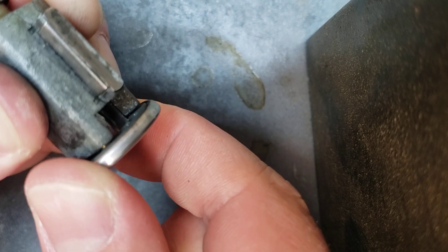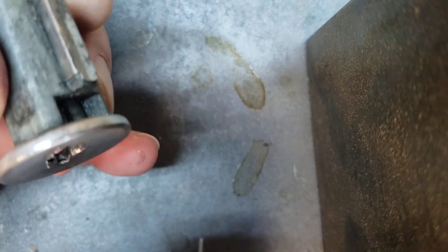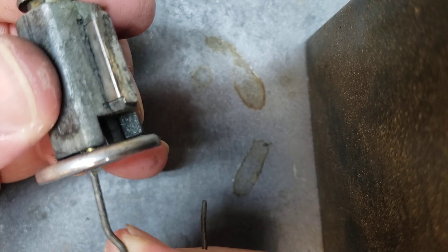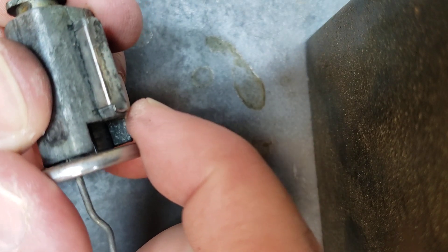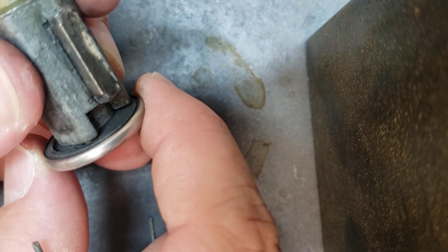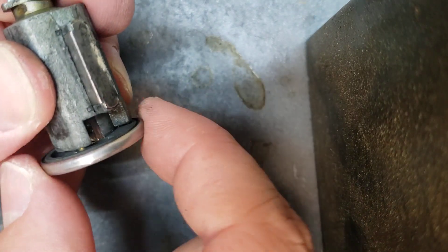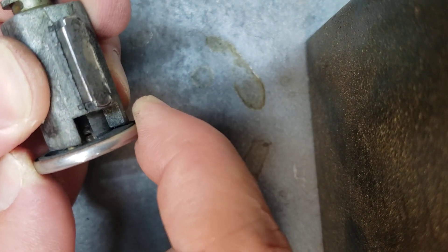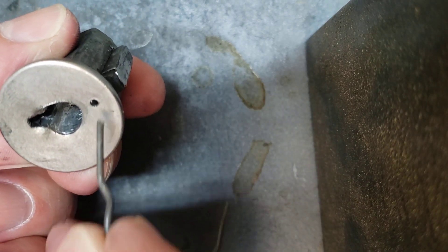See it drops in, and then you're locked. And these are all your normal ignition positions now. The real key there is that little brass tumbler and that light push. And that's why a pick is enough to make this actuate and pull these ignition cylinders out. It just helped me a lot to actually visualize the thing — so that's a very focused view on what this little hole does.